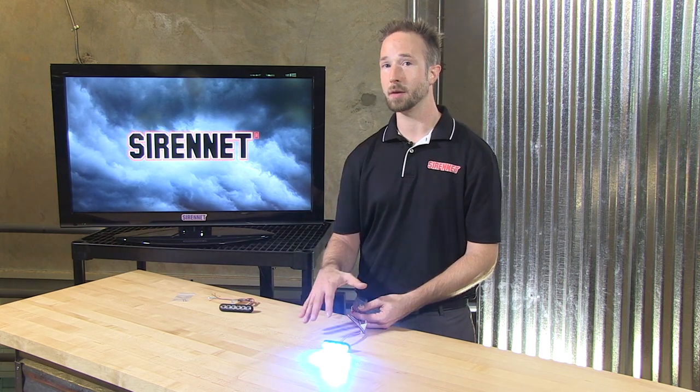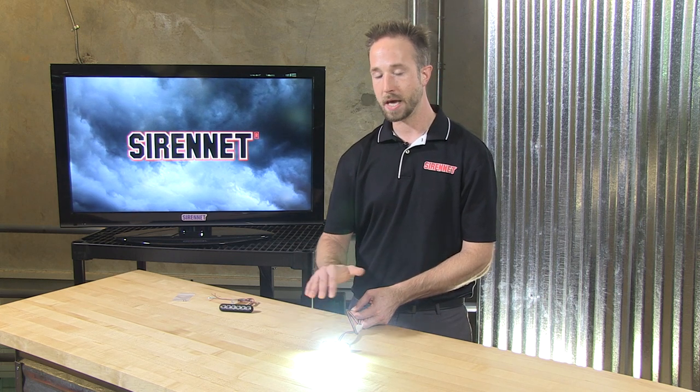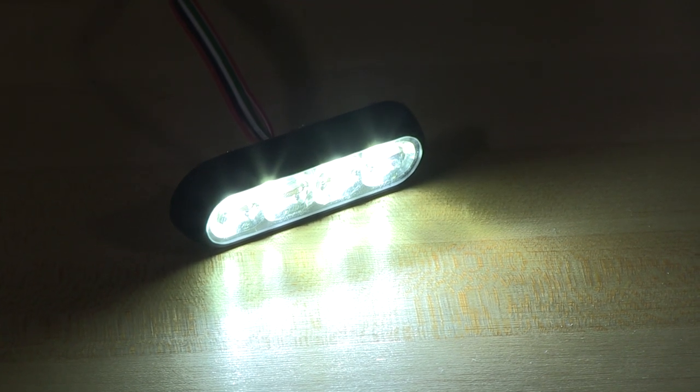Red, blue, white, firing away very nicely. And thinking about using this on your vehicle to enhance nighttime illumination — all you have to do is take this extra trigger wire here, the red with white stripe, apply positive 12 volts, and there you have it: a very nice, potent front grille light. So thinking of a slick top or a marked patrol vehicle, it's a great feature to add extra white outside of your driving lights or headlights, or for those wanting more power with interior light bar or overhead takedowns — tie this right into the same button for nice bright mid and upper level lighting.